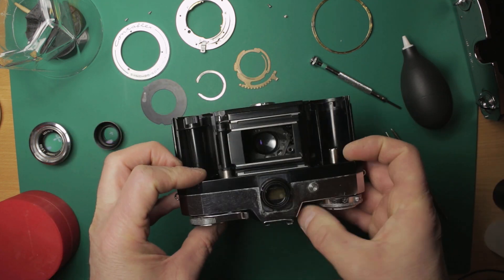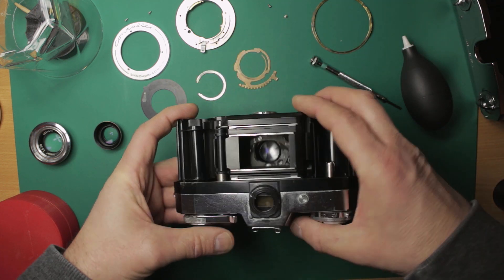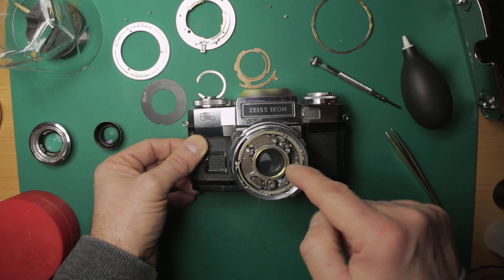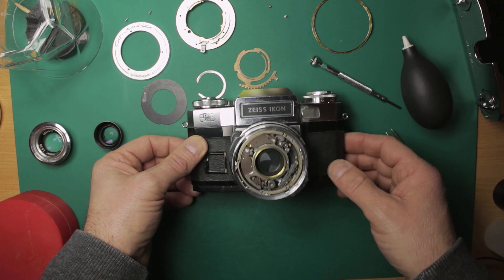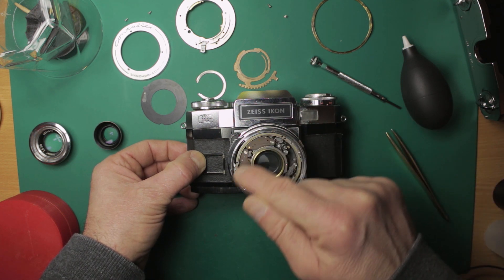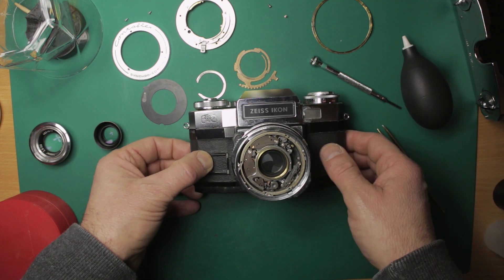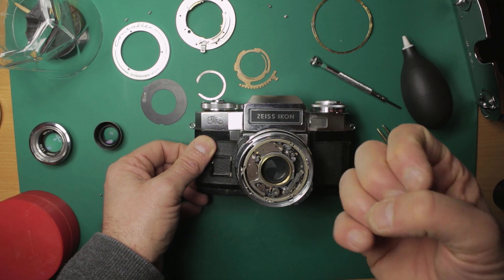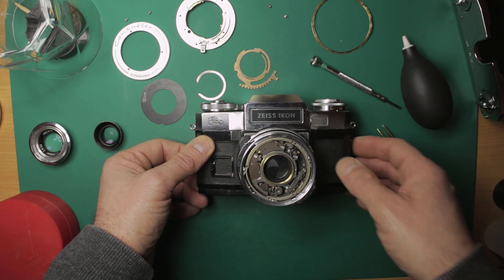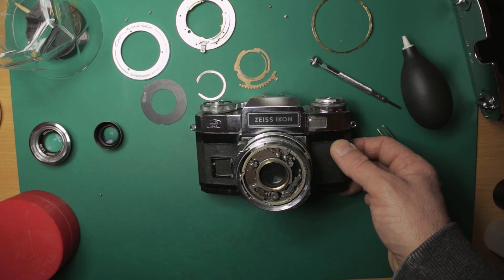This was quite dirty, it's had a really good clean up so far. I've taken quite a few bits off and given it all a really good clean with isopropyl alcohol. I've also done a little bit of cleaning and lubrication using lighter fluid on some of the gears, because these tend to get sticky with mechanical operated shutters like this. A bit of lighter fluid works wonders because it allows a slight bit of lubrication without putting oil around things — you don't want oil spreading inside things like this because it gets into places you just don't want it, especially onto the film.